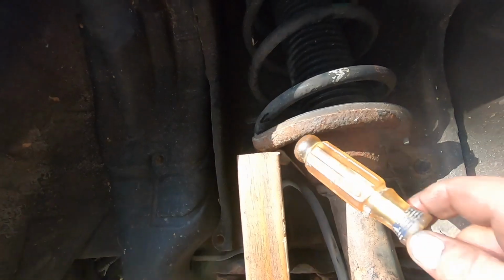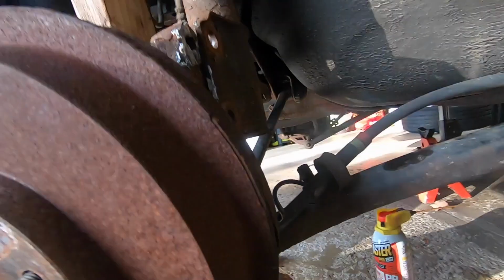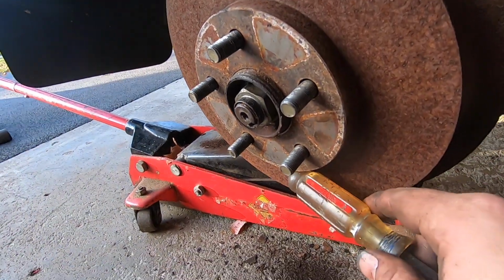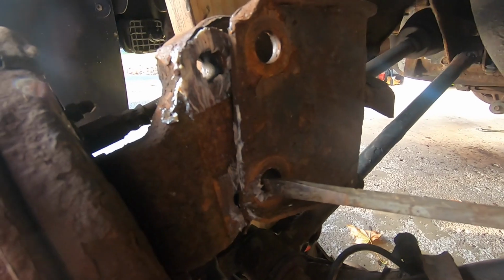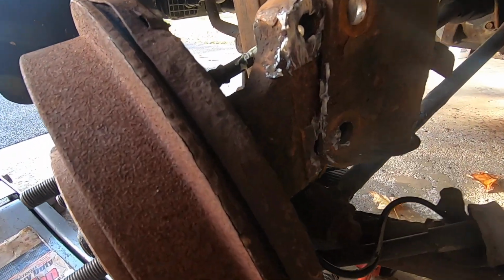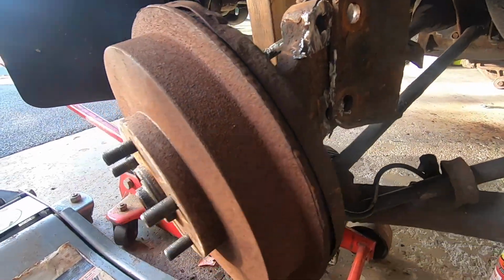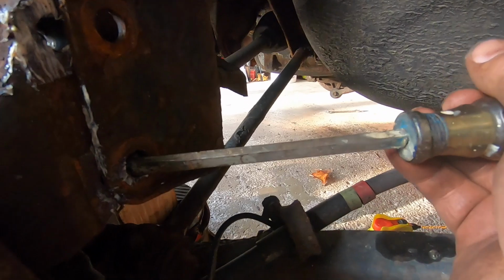This is how we did the 2x4. We pushed the strut up at this jack, and now we're gonna take a second jack from right here to then hopefully move this in. So you'll do the bottom screw first. Once you can get a flathead in there and actually reach the hole, then you can move this into place. So getting to that point is a little tough. Okay, got it finally.